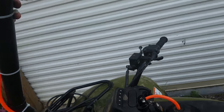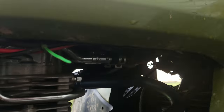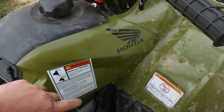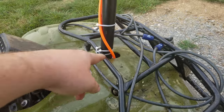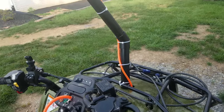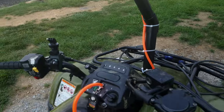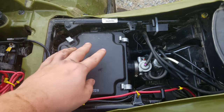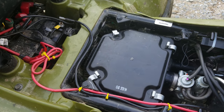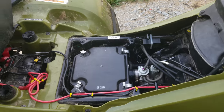That's not all — there is a crankcase breather up under there. It is 14 millimeter tubing. I bought a coupler that's going to go on it, then the tube's going to run up in the exact same place, and I'm going to have the breather up here so it doesn't go underwater. That will basically render this thing completely snorkeled so none of the yuck can get inside the motor. The only thing not waterproof right now is the air box. I think I'm just going to do some grease around it, because that's what I did last time and it seemed to be fine.